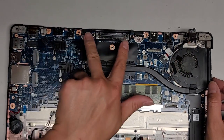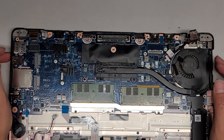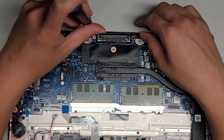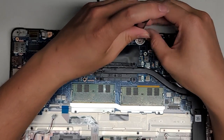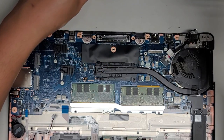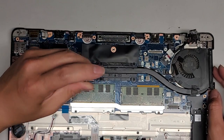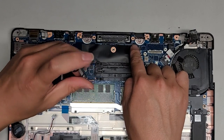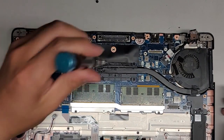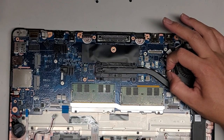As you can see, there are some hidden screws under here that we're going to have to take care of, and we're probably near completion of removing the entire motherboard. Let's go ahead and remove the two hidden screws here. They actually put some labels here — there's an M2 by 5 label here, so it helps you know where the screws came from. There's another screw here. The fan also has one here — the fan cable connector, you just pinch the wings and wiggle to pull it, just like the speaker connector. Then there are these two screws here — M2 by 3. And then there's one more M2 by 5 screw here.